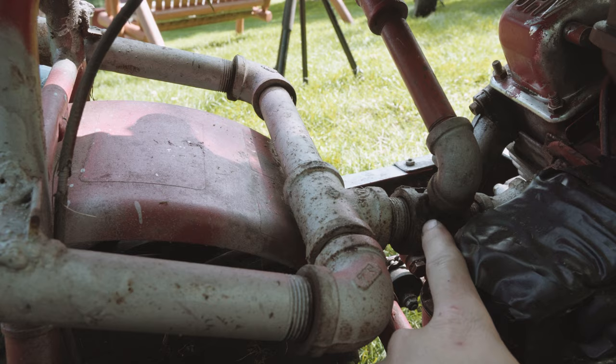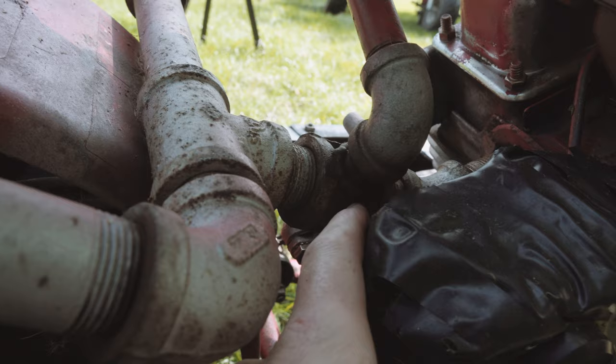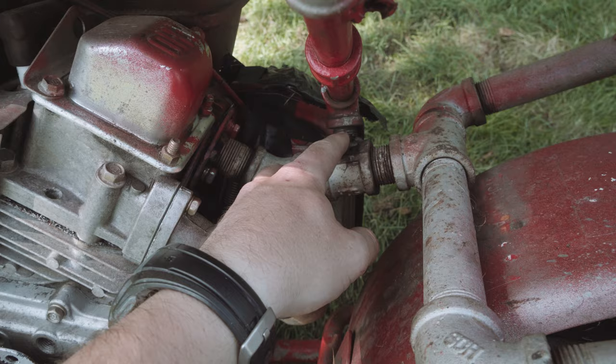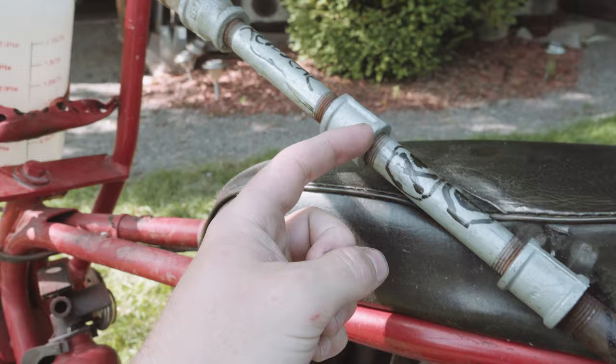For this piece here I drilled a half inch circle into the coupler, then I screwed in a 1 inch length of tubing into a 45 degree coupler, and on the other end maybe a 4 inch length of tubing. Then I poked the small end into the hole I drilled into the coupler and welded it all up, and then just half inch piping all the way.